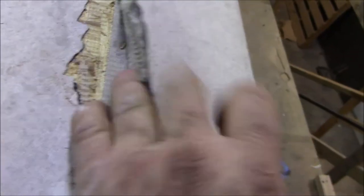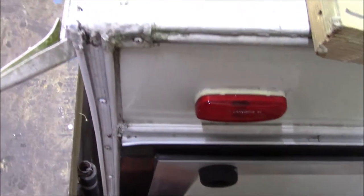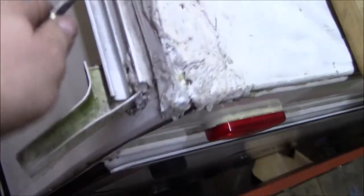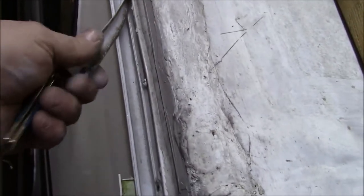The staples are loosened up on it - that's why you can see that big gap. Going around this side, there's a leak right here that runs all the way to the bottom. The water will get in these little tracks and get inside even though it's going down. If it's terminated wherever it hits, it's got no way out and it's going to leak. Someone tried to seal that up, but some of this stuff just shrinks over time, especially the rubber. This is just an insert track and we don't use this anymore. EPDM rubber shrinks - that's another reason we don't use it. It will shrink and oxidize.